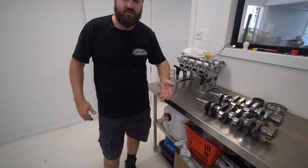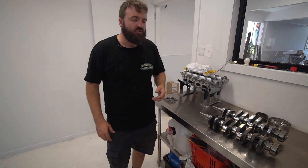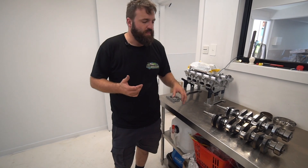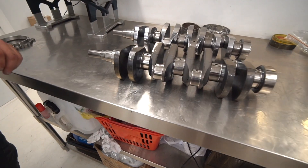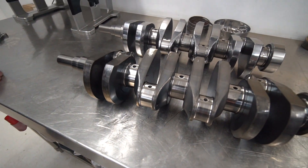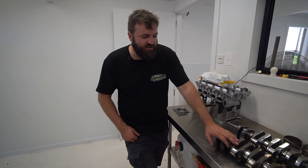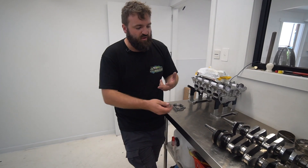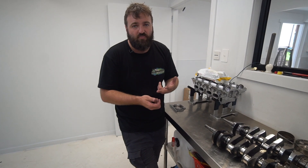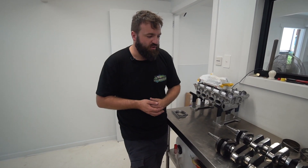It's just like cavitation on a prop in a boat, or a water pump spinning too fast — when you run water cooling systems with mechanical water pumps and overspin them, you get cavitation. That happens across the surface of the bearing. Air can then prevent you from removing the temperature from the crankshaft or the bearing. So a superfinished crankshaft is A, less likely to crack; B, you drop the cavitation across the bearing surface, so you're going to have a more resistant crankshaft — less likely to damage a bearing, overheat, melt a bearing, or grab a bearing.